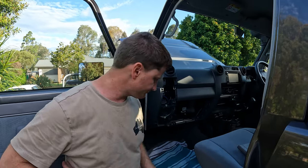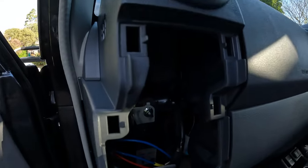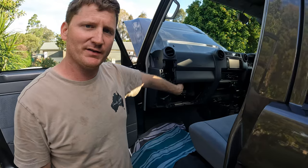I've just finished up doing the soldering for the TowPro - the power, the brakes, and the brake signal. I just pulled out the cup holder here so I could poke all the wires out and did all my soldering there. I managed to tuck it up under the dash. I haven't seen anyone mention this spot on any 79 pages, and I think that's the perfect spot - the clearance and everything is good there.